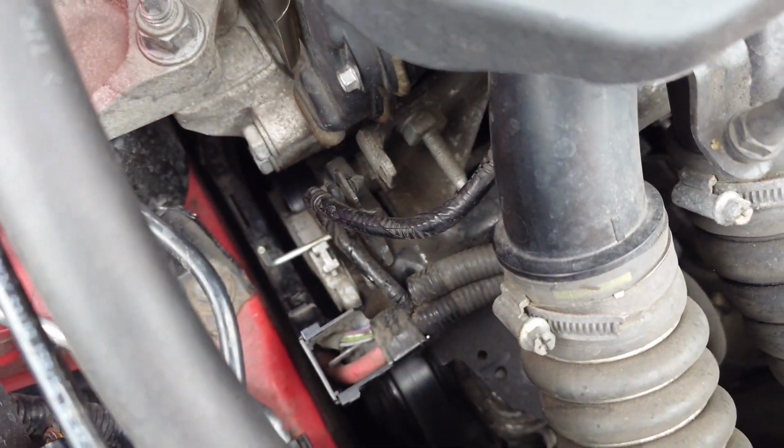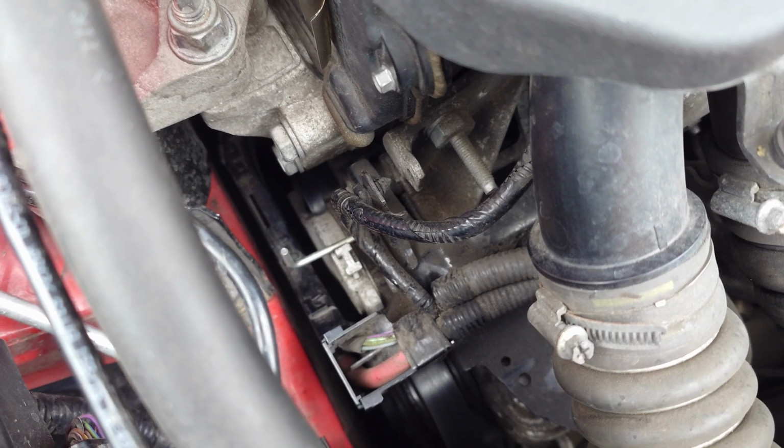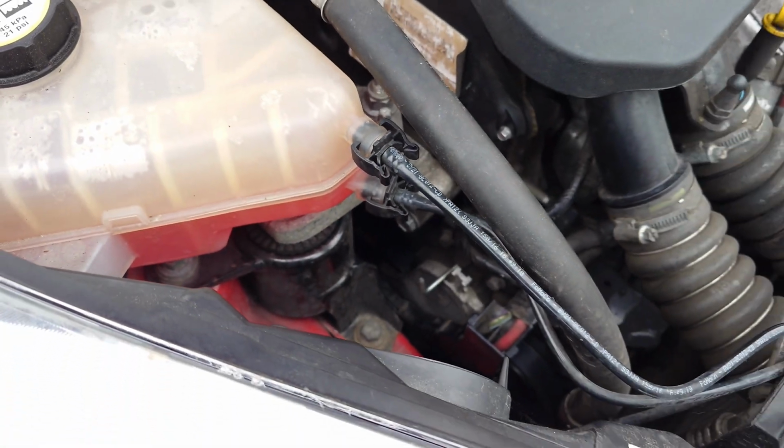And now this is another clip with the alternator belt disconnected. You can see the noise is still there. The alternator is disconnected. I was thinking it was the alternator in the beginning, because I have repaired the pulleys in the past and they are a pain to remove. Some people would rather just put a new alternator on it, which is what I did. Changing the alternator on this car is a big challenge because there's not much space in there.